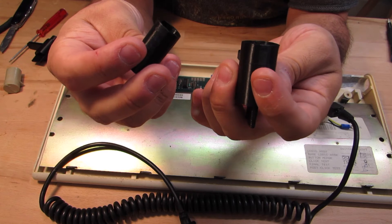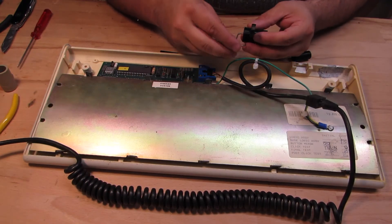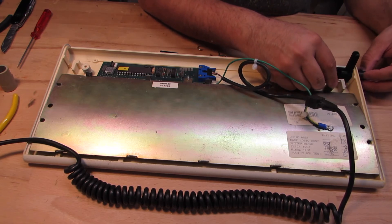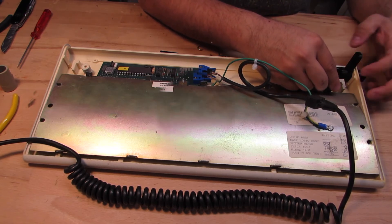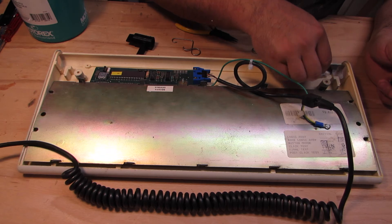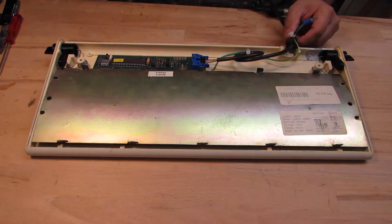This piece consisted of two printed elements with a center piece that I won't need. I remove it so I can properly insert the spring. I'm not sure if that was the case with the original feet, but I think it's a good idea to apply some grease to decrease the tension and physical stress on these moving parts.